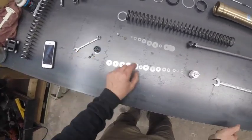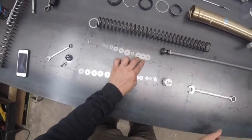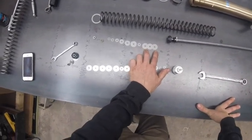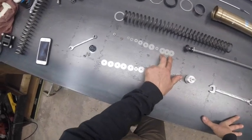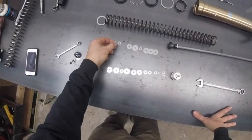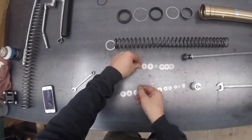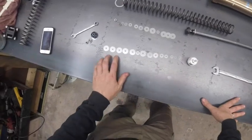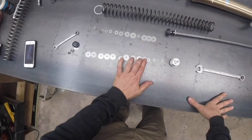At this point you're going to adjust these shims to basically give it the damping that you're looking for. If you want more low speed rebound damping, for instance, you're going to go stiffer on this stack of shims. For more high speed rebound damping — honestly I don't think anyone's really going to care so much about the rebound for these bikes — you'd be affecting this part here. The stuff you're mostly interested in is compression: you have the low speed compression stack, crossover shim, and the high speed compression stack.